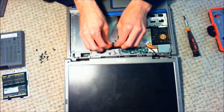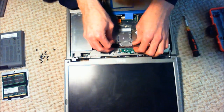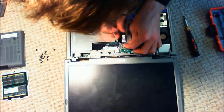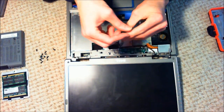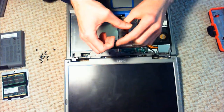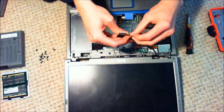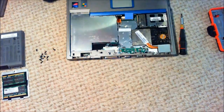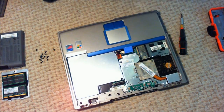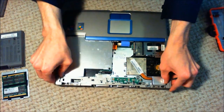The monitor cable should come loose pretty easily. Here it seems to be oddly connected to something else as well — I don't know what; I'm not familiar with that. I guess it's a ground. But in any case, that is off — screen gone. So there you go, that's how to take the screen off of a laptop, or at least this laptop. Most of them are going to be pretty much similar.